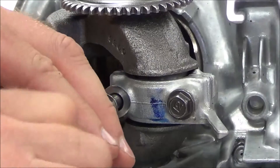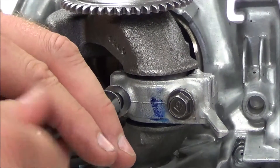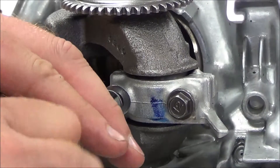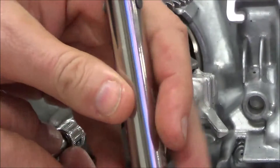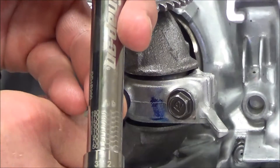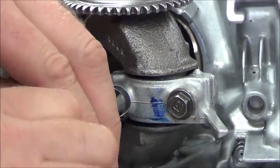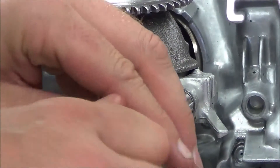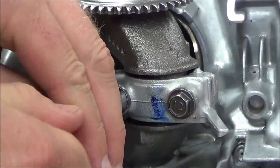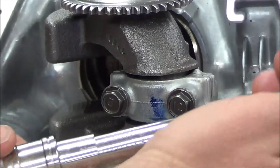We're at the bottom of the beginning of that tool's range, so it's not its most effective. So what we've done is take our 9 foot pounds and convert it to inch pounds. That translates to 108 inch pounds. We've really seen Harley-Davidson be a leader in providing inch-pound torque as a specification on their smaller fasteners.